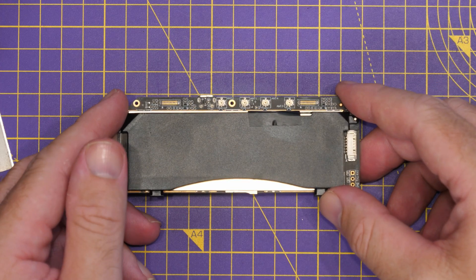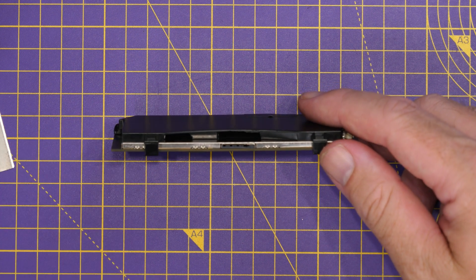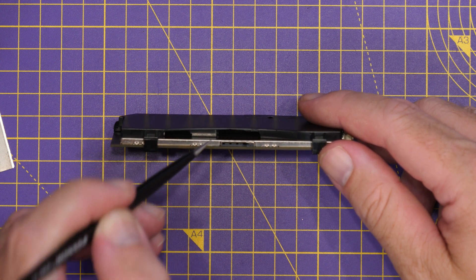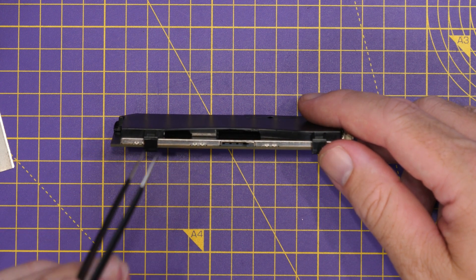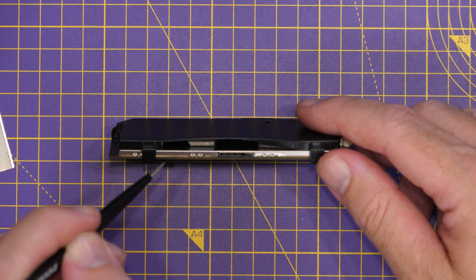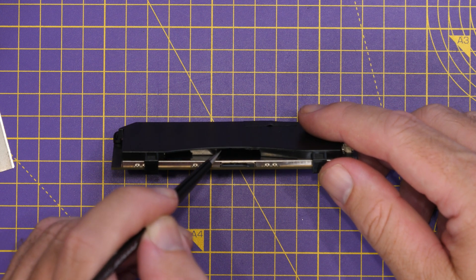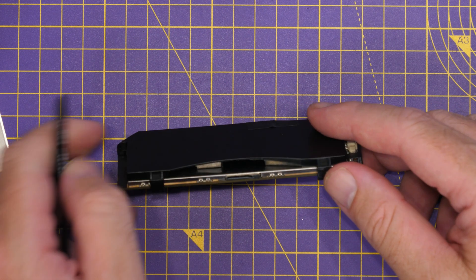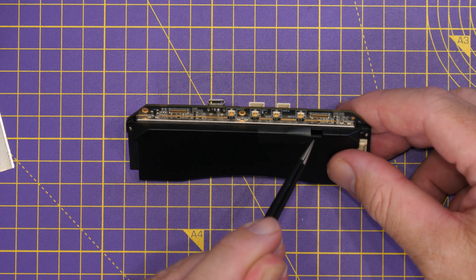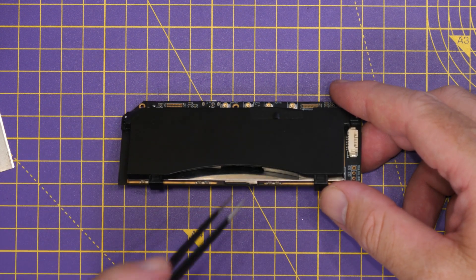After more testing and thinking, I think I've pretty much got it. What I ended up doing is removing that back area directly behind the duct that goes into the front of the goggles. I originally tried removing it in a different spot and it did nothing — so I wouldn't worry about that. What made the difference was taking that whole chunk out directly behind the vent and then restricting the airflow output at the front — that is definitely providing more airflow through the eyepiece.